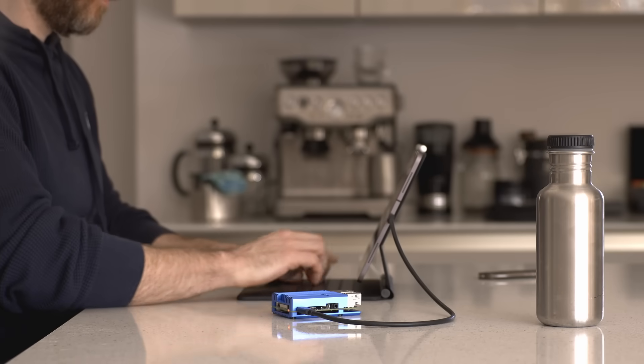I typically access my Pi 4 from a second-generation 11-inch iPad Pro — that's a non-M1 iPad. I connect my Pi to the iPad Pro using a USB-C cable, which allows the two devices to communicate over a virtual Ethernet adapter and powers the Pi from the iPad. I've tested the Pi with my wife's 12.9-inch M1 iPad Pro and it works just fine. All USB-C iPad Pros are essentially equivalent for this purpose. I haven't tested with non-Pro USB-C iPads, but Apple's website suggests it might work with the USB-C iPad Air. If you have a lightning connector on your iPad, you won't be able to use a wired connection, but you can power the Pi separately with a battery or power adapter and connect your devices over Wi-Fi.